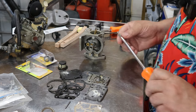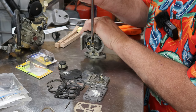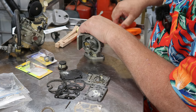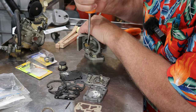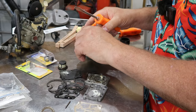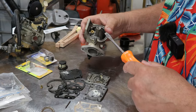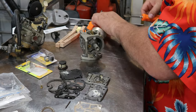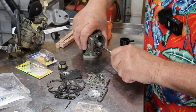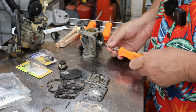When you're taking stuff apart like this, always use a high quality screwdriver - a good screwdriver has a good tip so you don't round things out. Make sure it fits in there - that one fits pretty decent. Not all the way in there, let's go to the next size down. There we go. You won't round things out and destroy it, make it look like amateur hour was here. There's another one down here - this one's just the right size. I didn't know if that was going to back out with some of that corrosion going on.